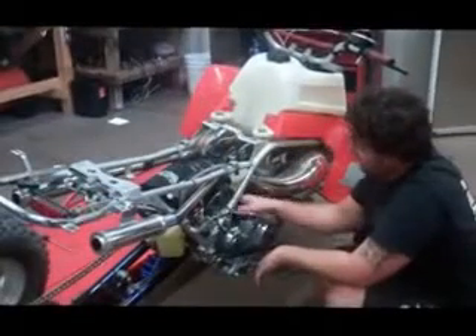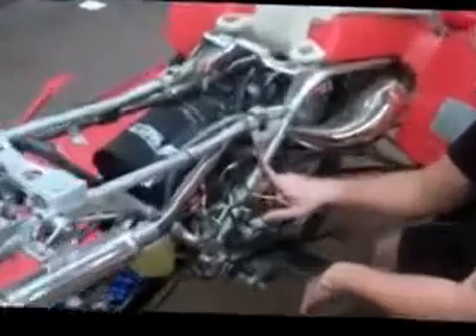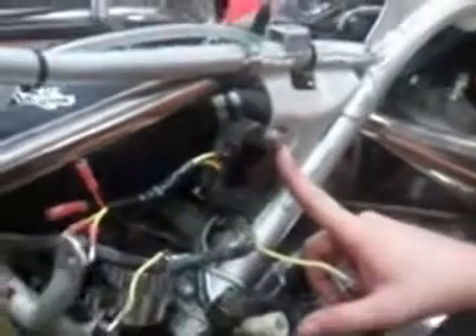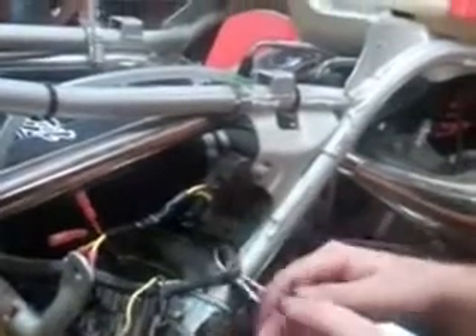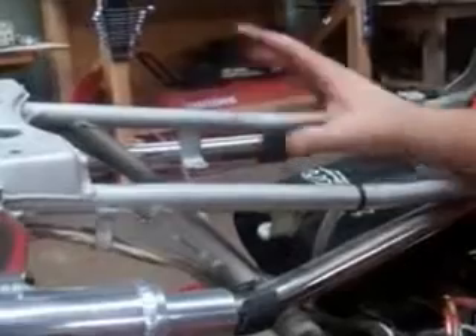So we're ready to plug it in and fire the bike. We've got the stator installed and the wiring harness routed. I went ahead and installed our regulator rectifier unit right here — we had an empty hole and a bracket on the frame. We don't specify where to mount this because there are lots of different ways to do it. Everybody's Banshee is different and these are heavily customized, so we're not going to tell you where to mount the regulator rectifier or your battery. If you do have this bracket open, it's a nice place to put it — it's out of the way and the connector length is perfect.